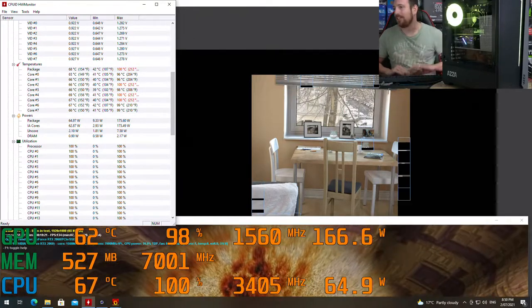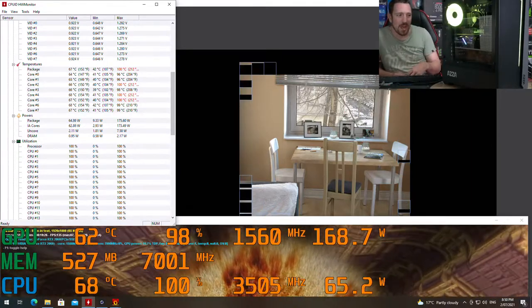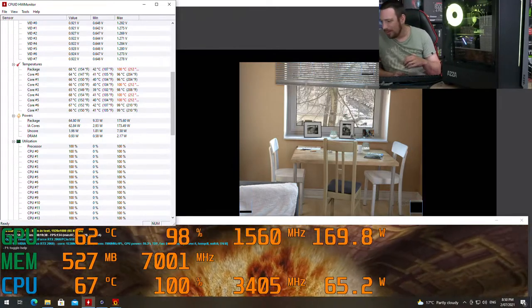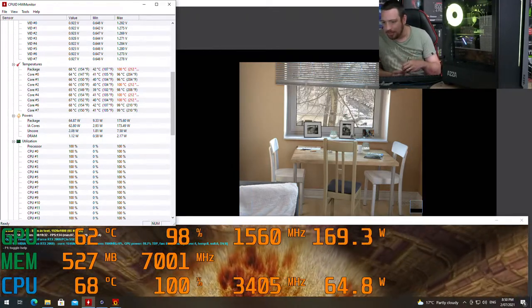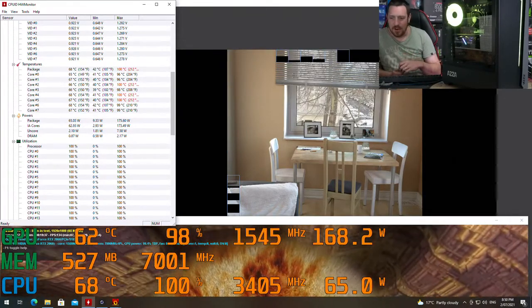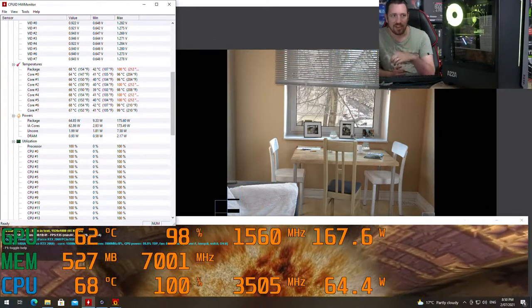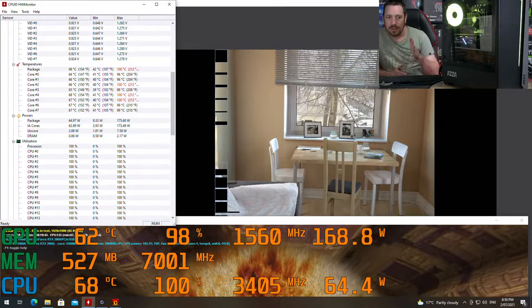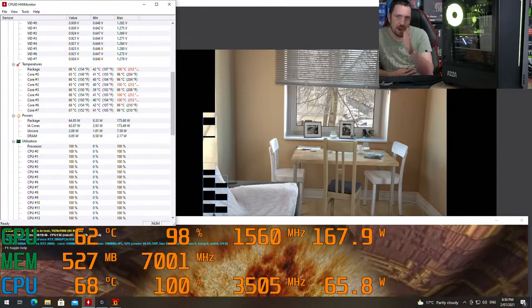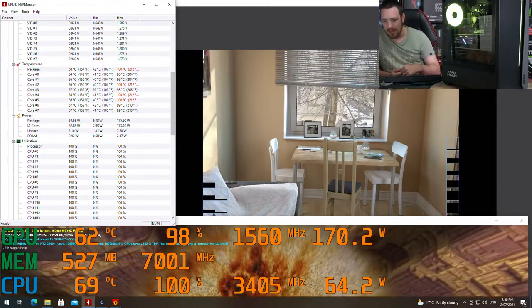None of them snapped off. Yeah, so you're sweet, you're golden. No issues there at all. You'll just be able to bend them back into shape. A credit card is generally too thick, but if you've got some other credit-card-like thing that's a little bit thinner, like half the thickness of a normal credit card, sometimes you can find something that's just the perfect thickness to fit down the rows of the pins. And that's generally the easiest way to do it.